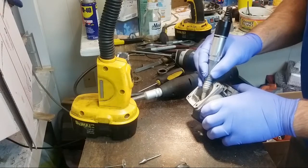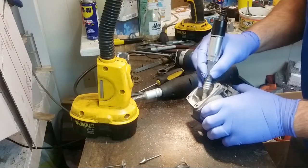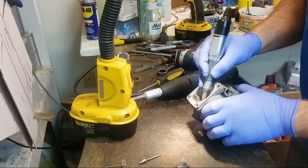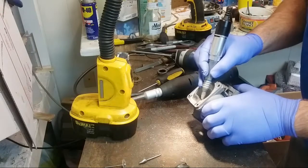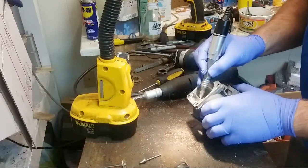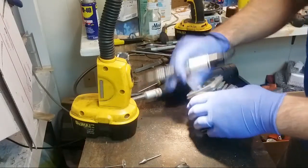In general, I like a very square intake. The rings don't pass it, so you can make it nice and square and sharp, essentially. Which, personally, I think makes the valve most efficient.